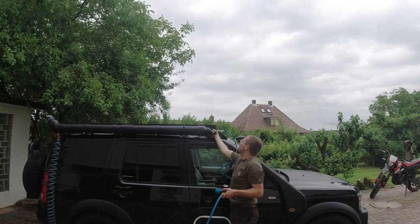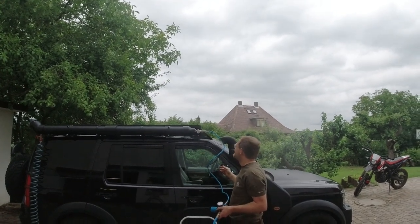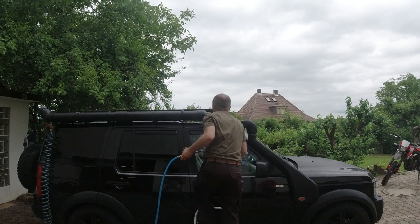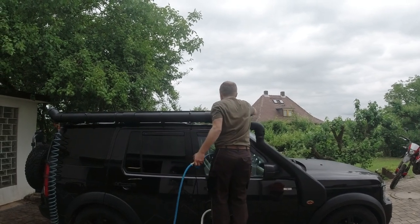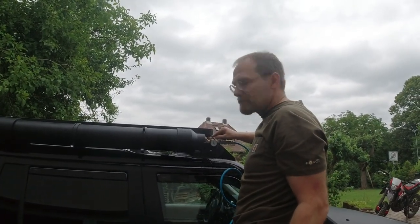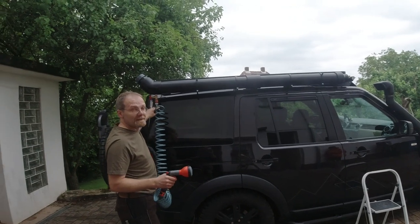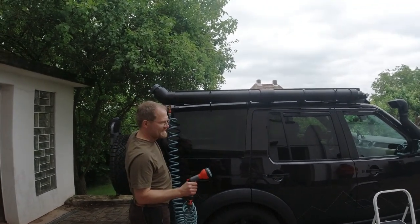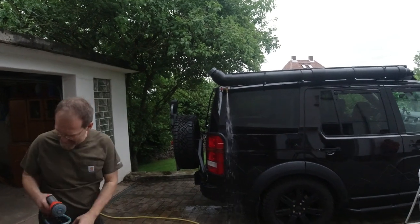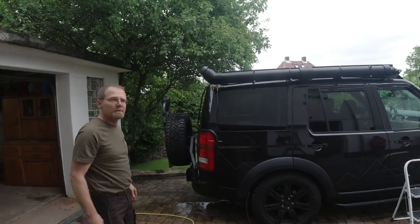Now see, when I actuate it now. Oh, okay. The reason it's leaking is that the spring can't seat it anymore. No. Now it's sealed again. It's leaking now. This is what I meant. It has now more pressure than it permits. And now it's leaking out that pressure slowly. That's already more than the Gardena stuff is rated for. Now look at that. Then the water actually runs out before the air pressure.